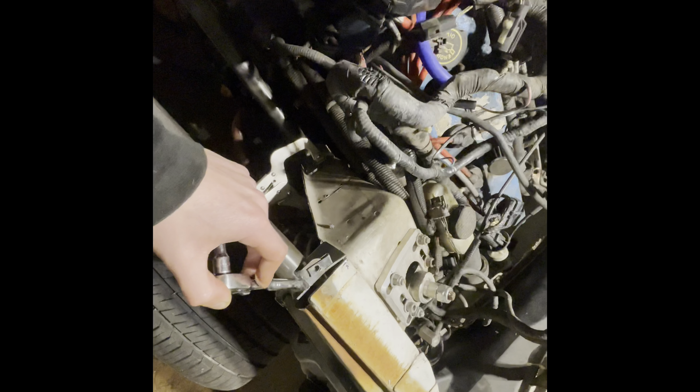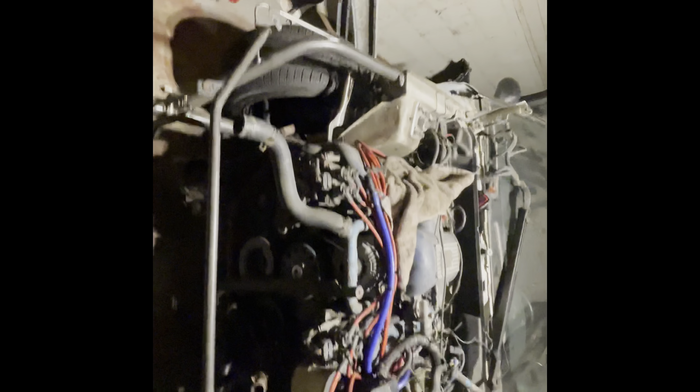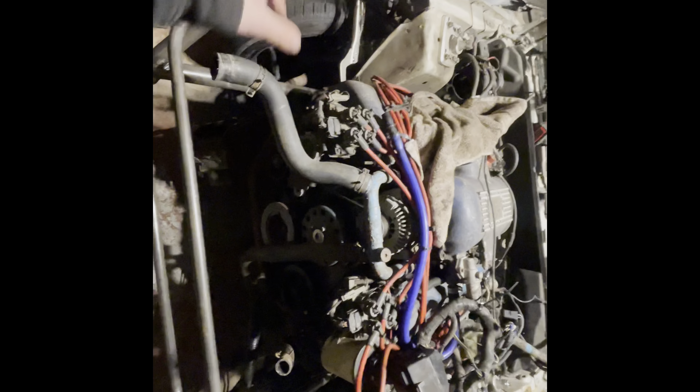So I'm going to pull this off now and get this thing off. I'm going to weld-through prime the backside of the tube front end, and I'm also going to grind down the strut tower where I'm going to be welding to, and weld-through prime that too. Weld-through primer is just insurance for the future — I don't want any rust on this car, that's why I'm doing what I'm doing. I'm going to use this right here — it's a 3M weld-through product. Then I'll get the welder over here and burn this thing in permanently after leveling everything. I'll show you guys that.